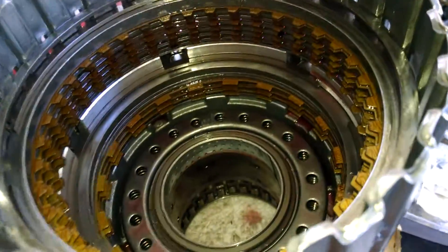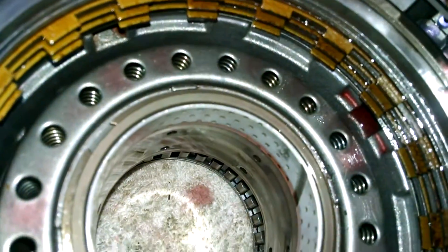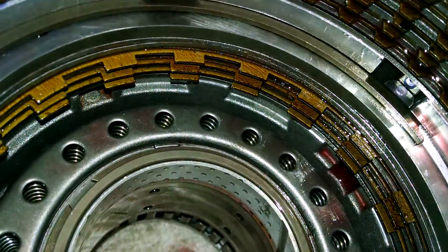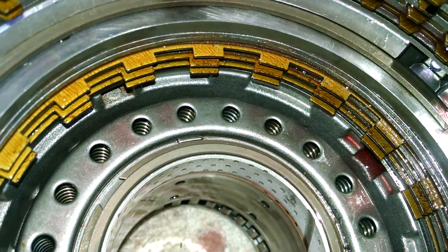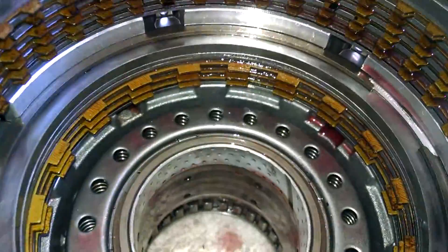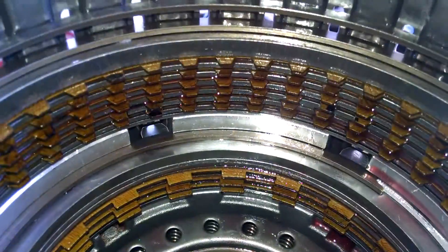The front drive drum is done. The bearing in there and the race seems good — no abnormal discoloration. The red tinge at the bottom may look copper on screen, but that's actually just transmission fluid, not copper from where the bearings wore through.